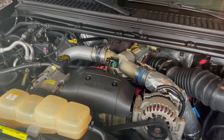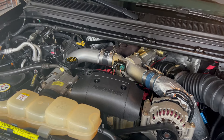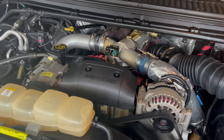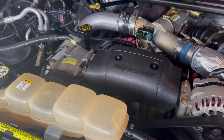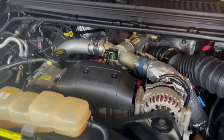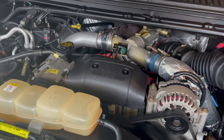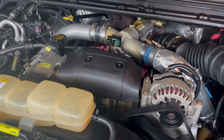In the instruction manual it doesn't say to drain the fuel bowl to change the fuel filter. It simply says remove the lid, remove the filter, replace, and fire up the truck — and that's exactly what I did. I confirmed this with the Ford coffee table books for the 7.3 Powerstroke, which go into great detail about the 7.3, 6.0, 6.4, and 6.7 Powerstrokes. Even in that book it simply states: remove the lid, remove filter, replace O-rings, and replace the lid.